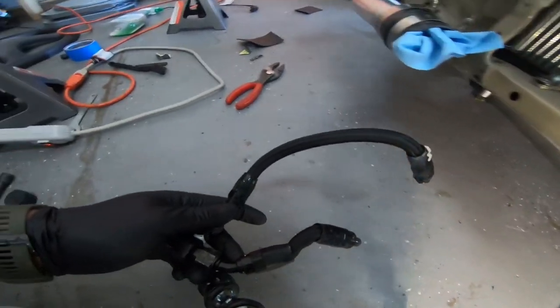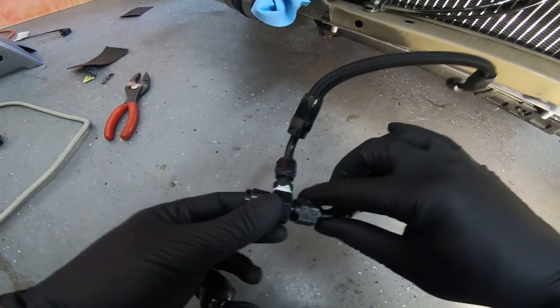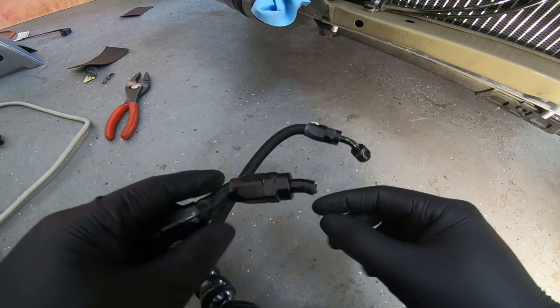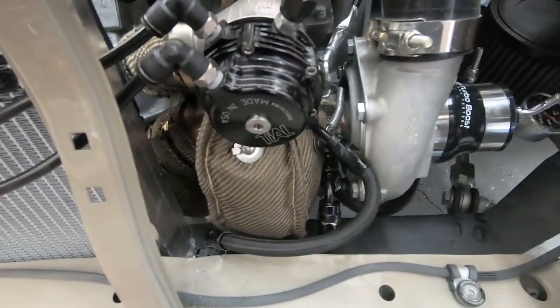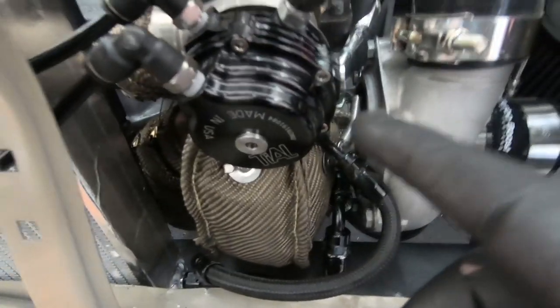When the jack slipped it pushed up into the corner of the radiator, puncturing it. The adapter from the drain plug was feeding to my wastegate and turbo. You can see it put kink pressure on the AN line — it physically broke the end fitting. So I'm going to remove those, add that adapter to this new bung here, and re-plumb two lines. Down there I've got 4AN going to the wastegate, 6AN going to the turbo coolant, and the boost controller lines running around the radiator up to the block.